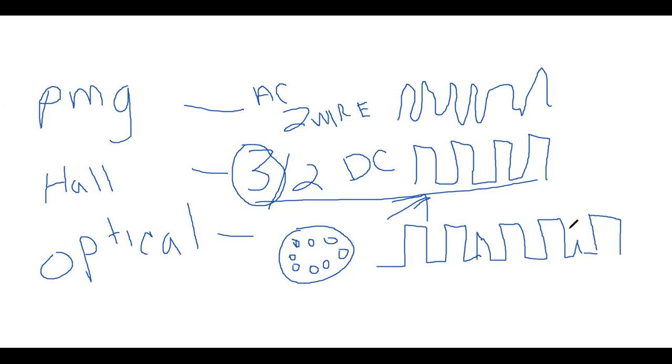Oh, okay, I see something's going on here and here. So the first thing I want to do is physically inspect my device. Then I remove the distributor cap, which is the type it usually has, and I see it's actually an optical distributor, or an optical trigger device. Then I would look at my three wires and figure out, do I have the proper voltage going in? Okay, 12 volts. Let me erase some of that. Do I have my 12 volts?